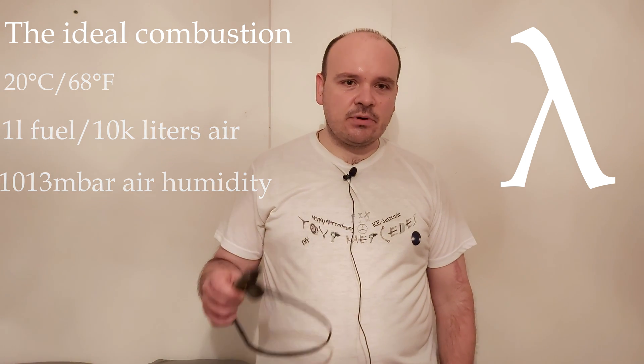All of those parameters is what this sensor measures, so it has to be in good state. Many people don't know anything about them. If you have a catalytic converter, then you have a lambda for sure. You have to replace it each 50,000 kilometers or 30,000 miles.